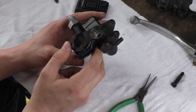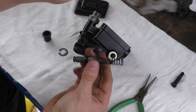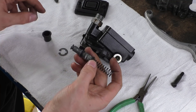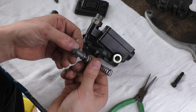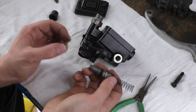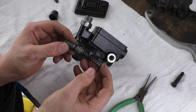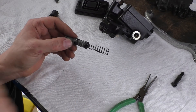All the gubbins that go into this bottomless pit of despair are here. We have a plunger on this side — this plunger sits against your brake lever and moves the piston for the master cylinder. You have the plunger section, the scroll section of the piston, a seal here, and a seal here. You'll notice these are angled seals — when you compress your fluid, it backs up and actually pushes the seal outward, causing it to seal so there's nowhere for the fluid to go.